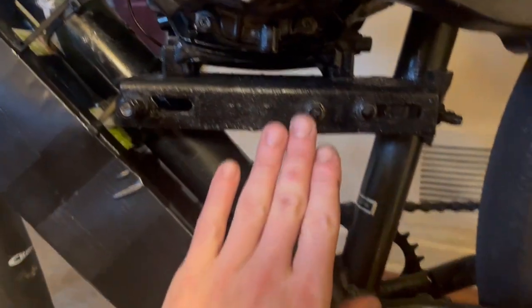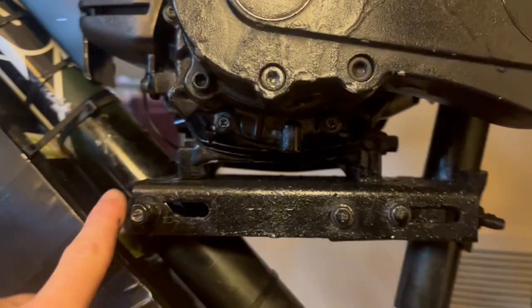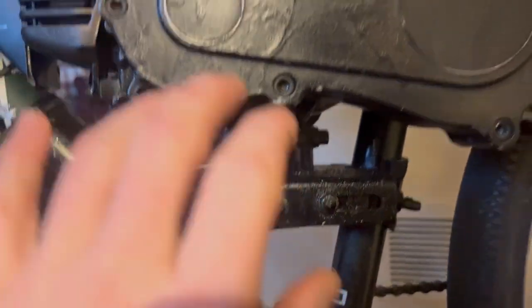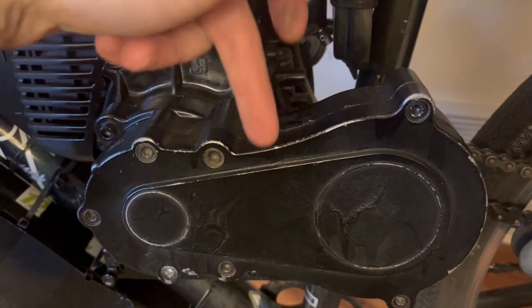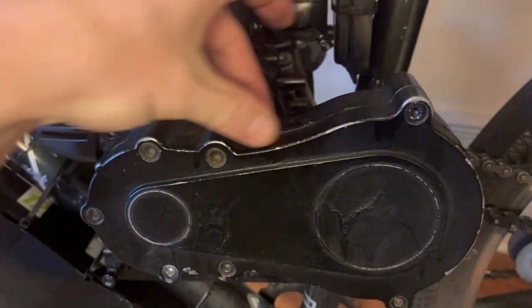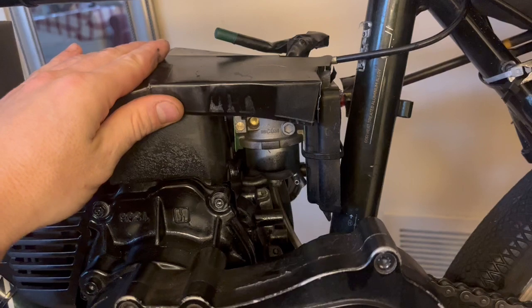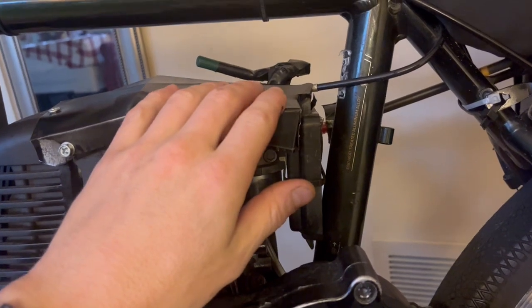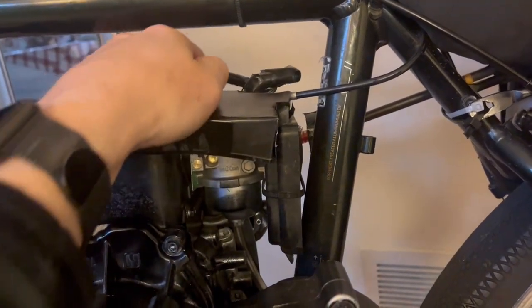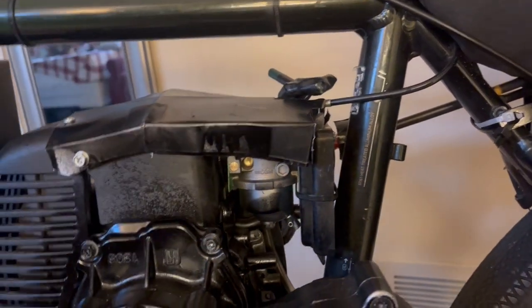This nice mount that came with the engine kit goes on really well with the brackets. There's a little rubber between all these joints to minimize vibration, and there's a nice dual-chain transmission up here — a chain here and a chain here. It basically runs the whole length. Very strong air box here. I made this cover to cover up the top valves and the carburetor, protect it from the rain. And here's a choke lever — choke on, choke off, slash drive.